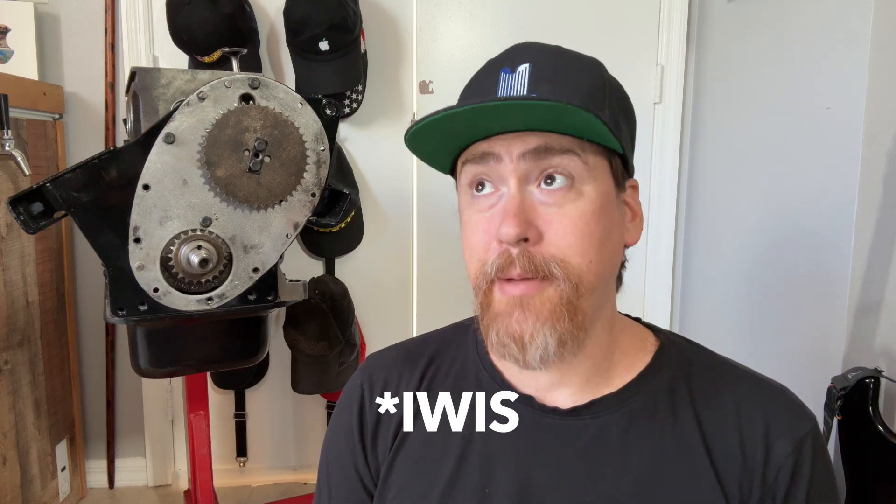In the last video I talked about some part issues. I showed the alternator I'm going to be installing. We got stuck with a sprocket being a little too thick, so I decided to stick with the original sprocket and picked up an IWIS chain — a high quality, German-made chain that should last a long time without stretching. But first we need to get this front plate sealed, because now that we know the gasket thickness we need to get that put on before we can talk about timing.